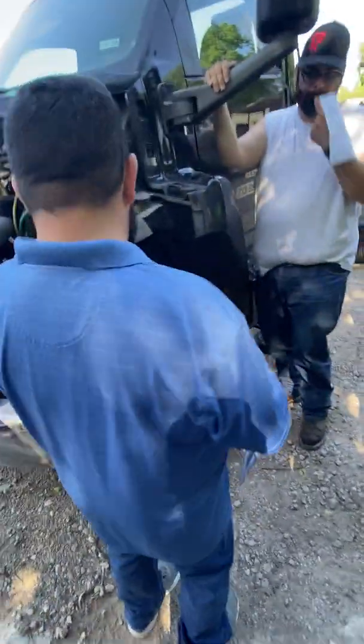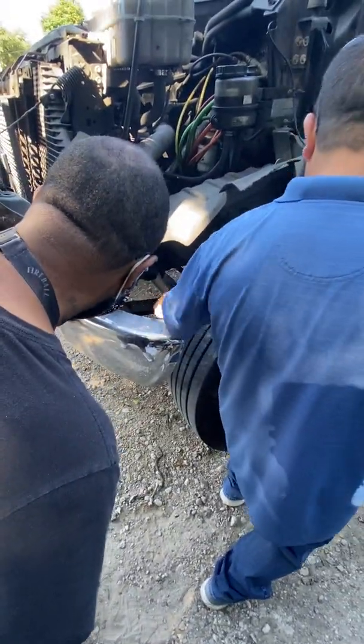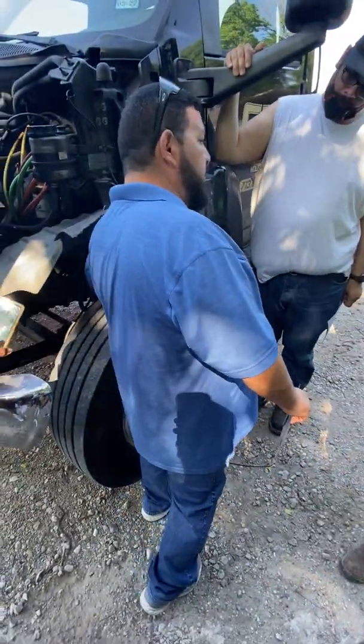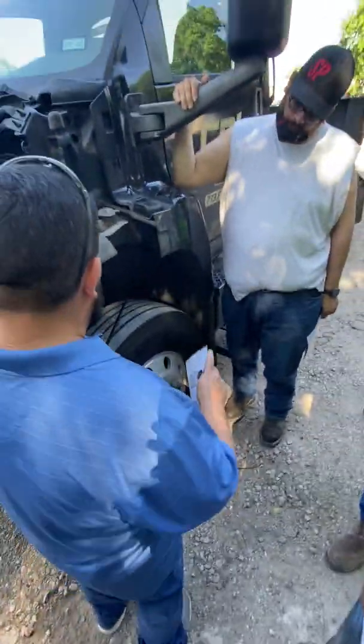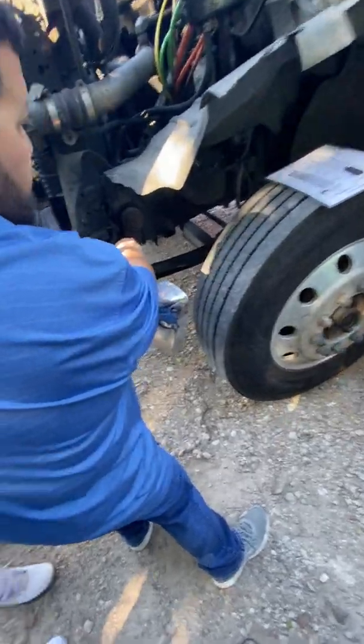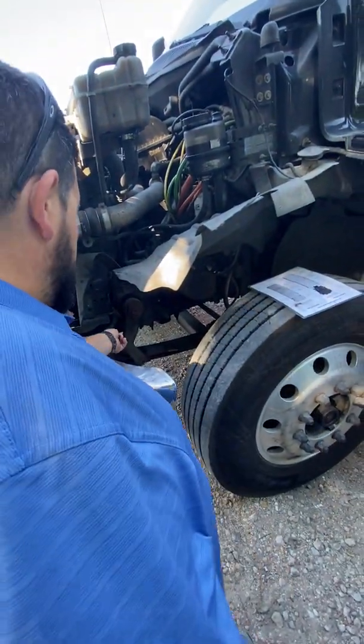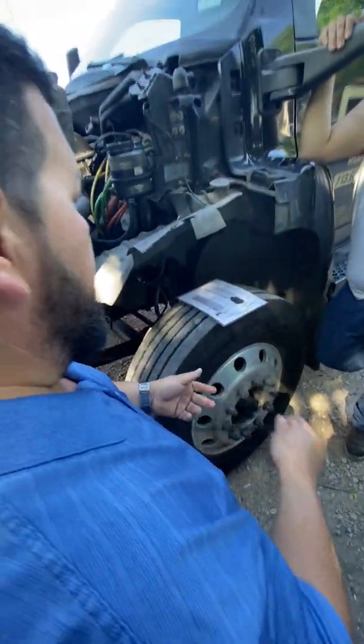So you have to at least point and tell them, hey, look, I got a spring mount right here on the front holding the front of the leaf spring, and there's another one over there on the back, and just point back there. And what I have to check on those, well, if you look right away, they have the nuts and the bolts holding them, so I'm gonna make sure they're tight so nothing's loose. And the condition that they're not cracked or broken, otherwise my whole suspension is gonna fall off and be loose.